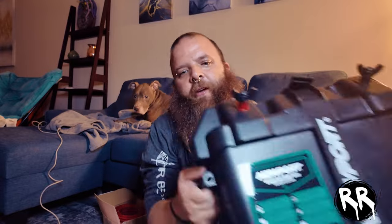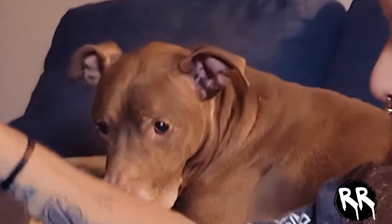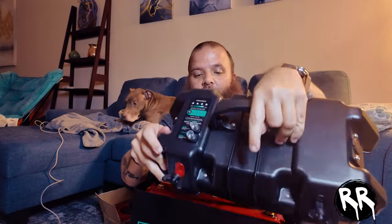Here's what we've got. So here's the dual battery — it's going to be my second one. It's actually a case I found that makes it easier, so I don't have to set the battery loose in the trunk. I got the deep cycle AGM battery in the case, and it wires up with terminals on the outside — that's where the hot and ground wires will connect. The case also has a 12-volt adapter, two circuit breakers, and a USB port built in.